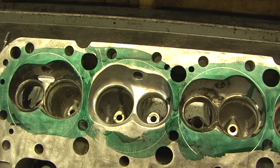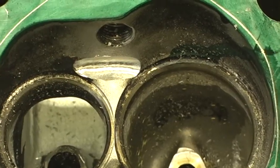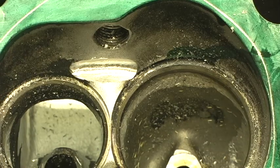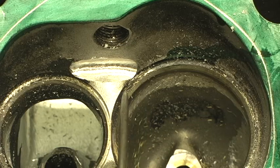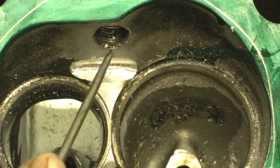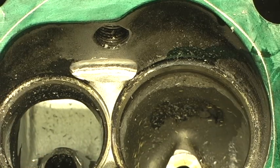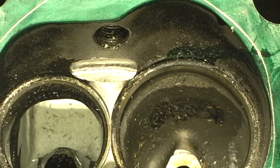Over here is the starting mark process. You can see how I ground that way and then ground that way with a pull and didn't even touch the seat on either side of it — so my seats are good. But you can just tell there's a trench that goes straight down off of that thread on that spark plug, goes down, rolls into it, and then comes straight across. Then what I'll do is take my straight bit and start gnawing at that and level it to where it goes into it.